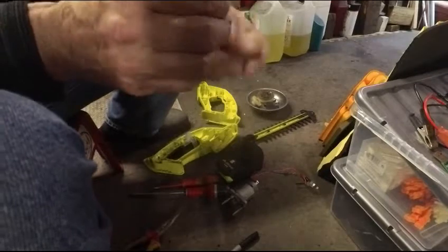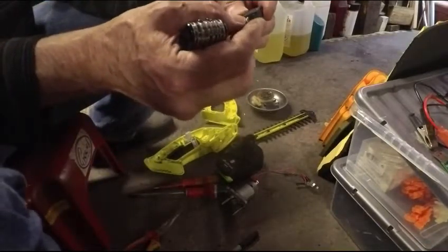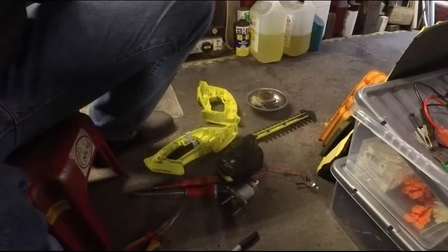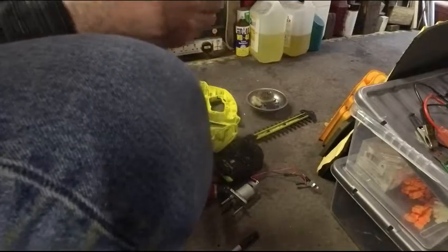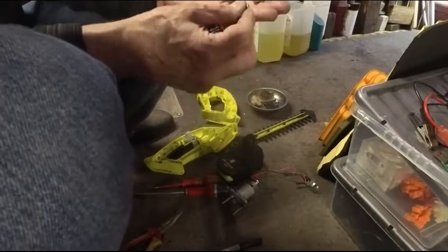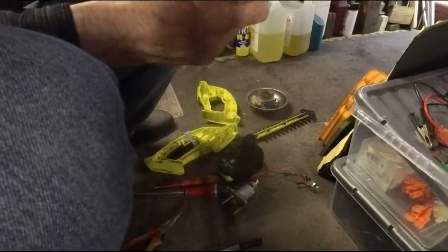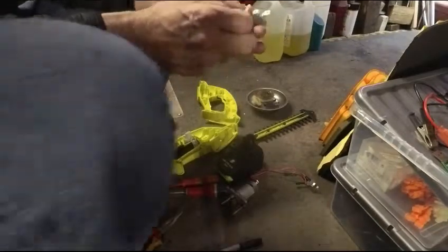have a look at the markings on it. So according to the markings, it's rated at 15 amps, 125 to 240 volts or 250 volts AC. Yeah, interesting choice. I don't suppose I've got one of those. You never know that. I'll have a quick look. Well, would you believe it? I've got 2 to choose from. They're both 22 amps, 250 volts AC, and they look to be the same footprint, aren't they?